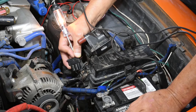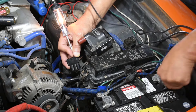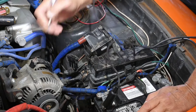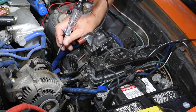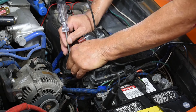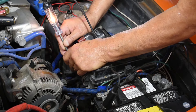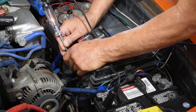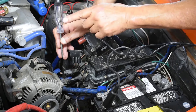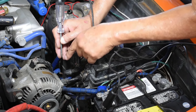One wire down and one wire to go. It's time to check for negative. To check for negative, I'm going to reverse polarity — take the jumper alligator clip here, make sure my test light's ready to go, go to the other wire. I want to show you how we're going to blink. Helper, please crank it over. Did you see it? That is our pulsating negative. That's how coils work — you have a steady hot with the key on, and you have a pulsating negative.